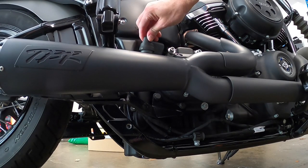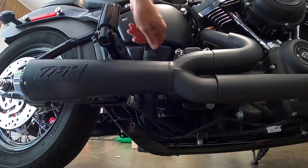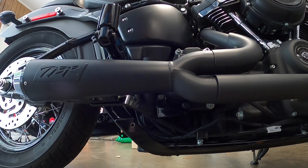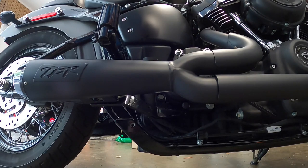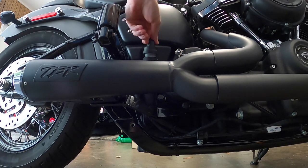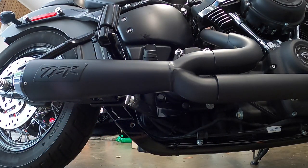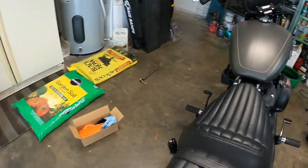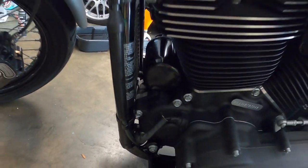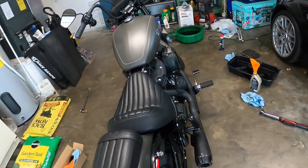I'm going to start it back up and let it run for a bit, then check it again. After running it some more with it nice and hot, it's right at the full line. So it takes right at five quarts when you're all said and done — though it may vary, just like cars. Definitely want to always do your checks. Checked underneath — we're not leaking anything down there, and not leaking anything around the oil filter. Should be good to go. We're at 2,000 miles now, so I'll probably do the next one at 5,000 and go ahead and do the transmission and everything.